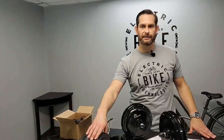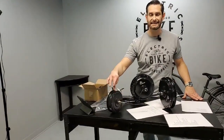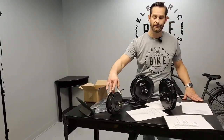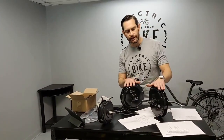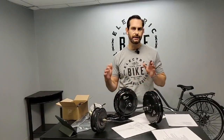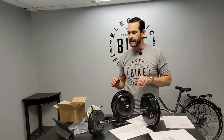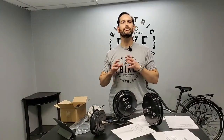Performance comes in five sizes: 700C, 26, 24, 20, and 16 — because it has a smaller diameter, we can do that. The larger one, the direct drive or Heavy Duty, that's going to be 700C, 26, 24, and 20 would be the smallest you can build with that. The main reason you would choose one over the other would be weight — how much total load is going on the bike or trike that you're building.